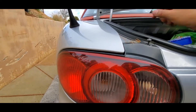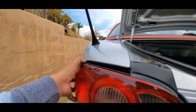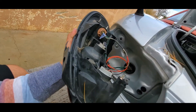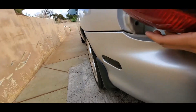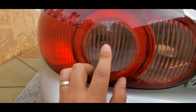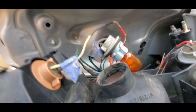After you remove the nuts, you should be able to pop off the tail light — that's why I'm going slow. Filming with one hand while working with the other is kind of hard. Got that off. It should just pop off; you might have to wiggle it depending if you've done this before — sometimes it can be sucked in there. This is the back of the tail light. My cable wiring is a bit different because I tapped it for the flying Miata side markers, but don't worry about it. All you have to worry about is removing this bulb — twist it off and it'll break free.